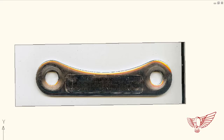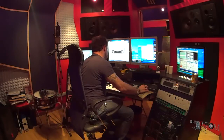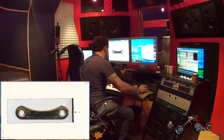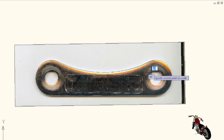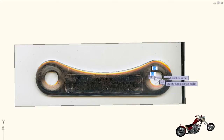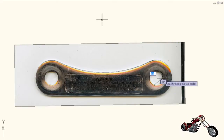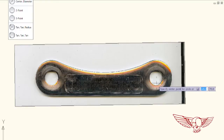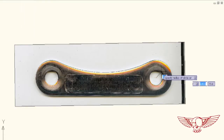Industrial and homemade products are both created having to respect the same mechanical and physics rules and limits. So I usually suppose that the engineer who designed this part followed the same thought process that I would have. If I were him, I would have started by making the concentric circles tied to an existing geometry — so I start with the fork hole, and then using the center of this circle I create the outside circular edge.